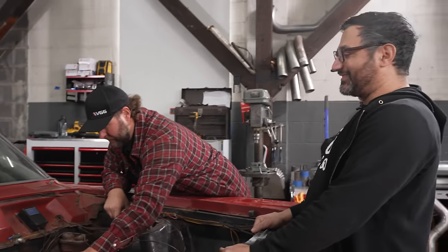Well, what do we do for motor mounts? So here's the story at the moment. This is a big block factory car, and essentially those would pick up a big block happily, but not ours because the rubber's in the other spot. We have the stuff that bolts to this motor. We found a guy that has these. We can pick them up at 5 today. We're in a bit of a crunch. So we can either get our accessory drive and trans all dialed up, and then Zach will run out and get those mounts, and we can do a drop-in situation, or we can start getting the welder out and some tube and get wild. I'd rather go drop-in.